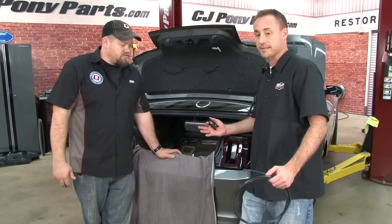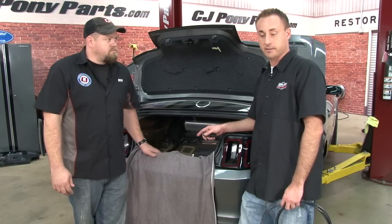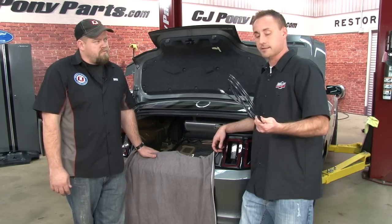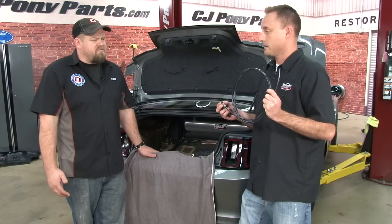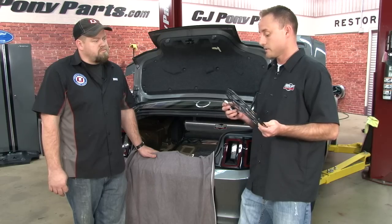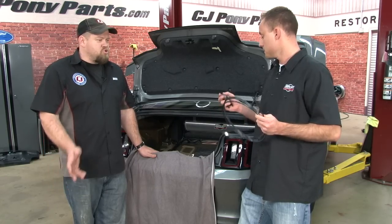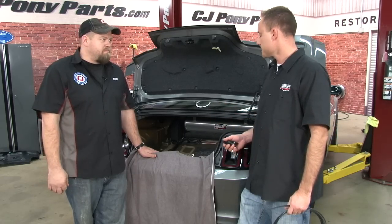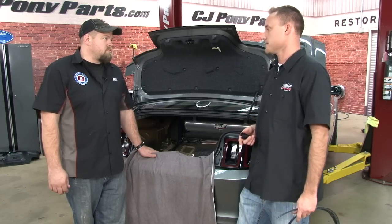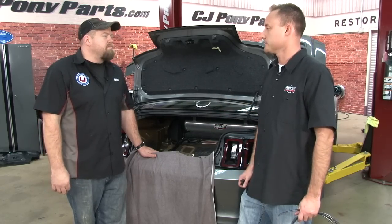We've got to connect everything together. There's already a line going from the compressor to the tank. There's also a line with a regular tire valve — that's for if the compressor ever goes out and you don't have air, you can hook it up to a regular shop air compressor. It will also drain the tank — it's almost like an emergency backup. When the compressor is running and compressing air, it's going to make moisture in the tank, so periodically — every other month or so depending on where you live — drain it, just like an air compressor in your house.